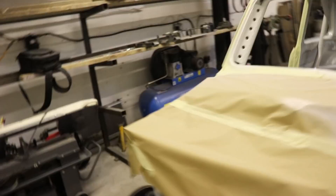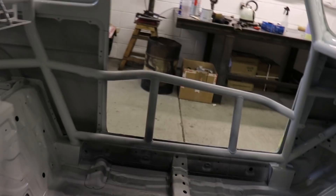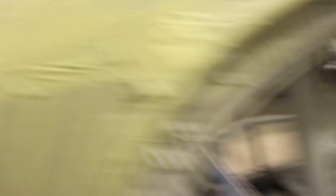Yeah, not quite going to plan. Before I started I obviously drained the water out of the compressor, and I've got this dryer which has a big paper filter in there — it's got a new filter in it. So the only thing I can think is that there's water in this line. Some bits of it have come out all right. But what was really noticeable was I had the heater poking through here and it heated up the top of the car. The paint that's gone on these top bits has just gone on nicely, whereas everything down here is where it's all just running off. I think a lot of the problem is I've just put too much paint on it — you can see it's like sagging down.